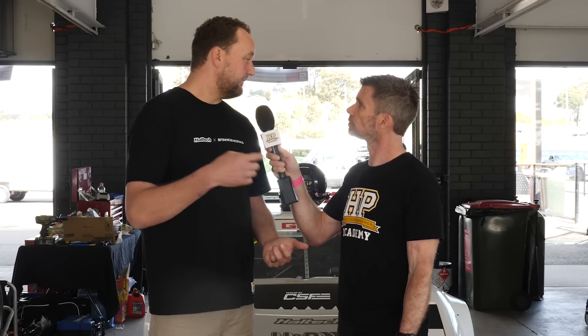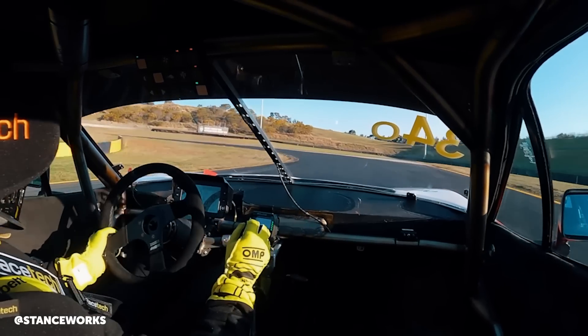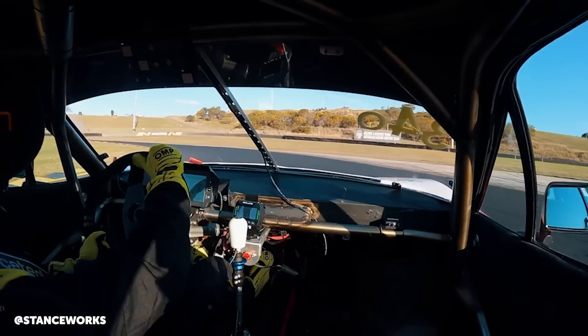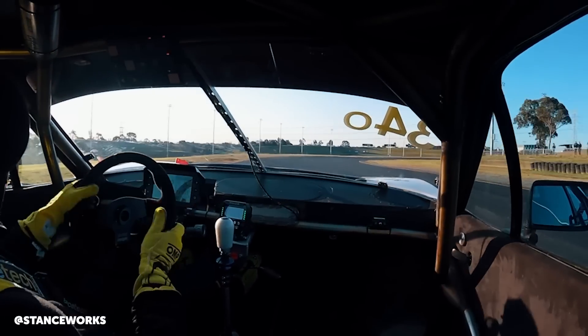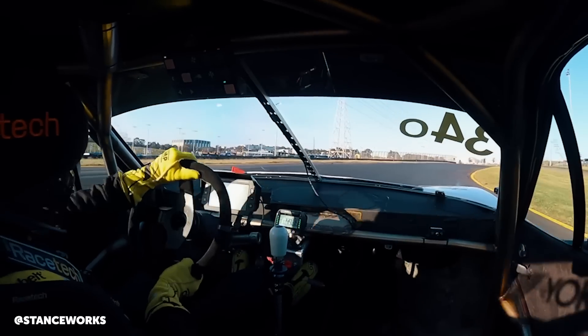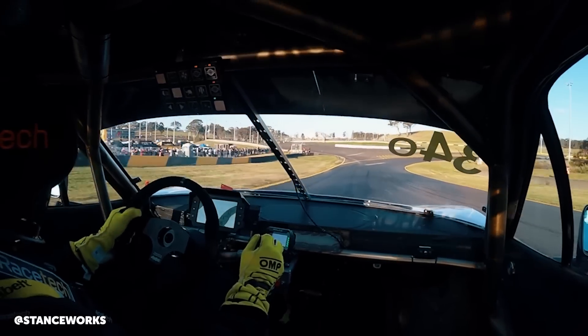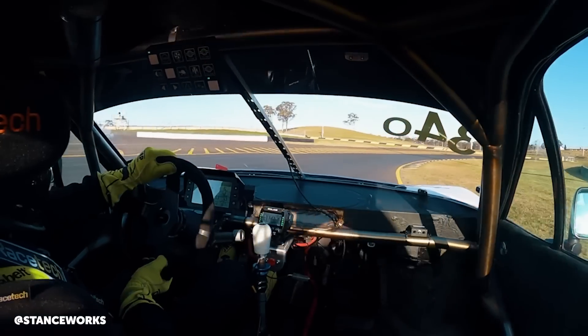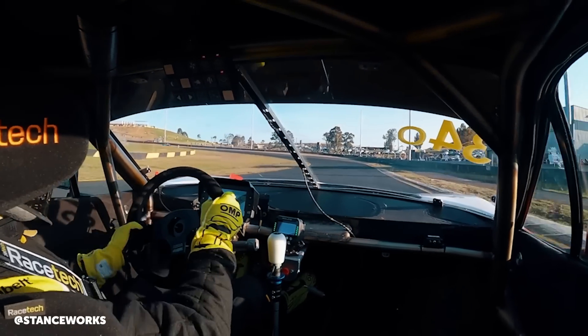How's the downshift handled in the Ferrari? We do a downshift throttle blip — a little more expensive if you mess it up on the downshift. What's happening is if we perform a downshift, we do a rev-match using the gear ratios to know what engine RPM it's going to in the lower gear. The throttle blade opens to target that RPM, then it cuts, gets us back into the lower gear, re-engages — and we should achieve a rev match very similar to doing a manual throttle blip.